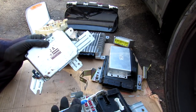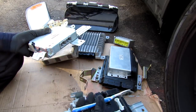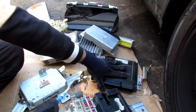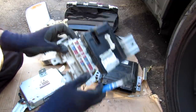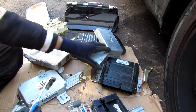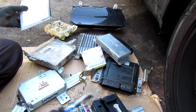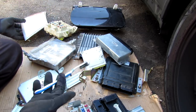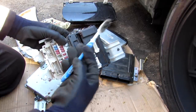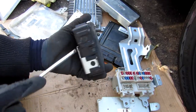Now let's look at some of the electrical loads that wiring harnesses plug into. Each car can have dozens of computers — the body control module, engine control module, immobilizer, stereo amplifier, airbag module, instrument cluster, and external lights are all examples linked together in the electrical system. Each module communicates through the CAN bus. Opening up the immobilizer module — the black box of magic that stores all your key codes — it's really important to understand how circuit boards work inside in order to diagnose properly. Most data sheets are available just by googling the part numbers on top of the components.